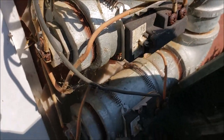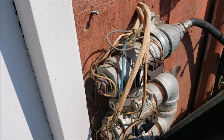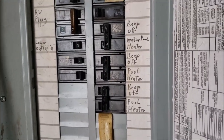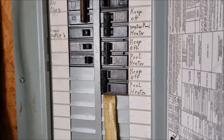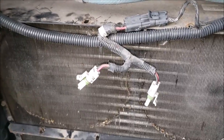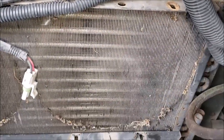Cold water feeds in from the bottom and hits element one, then two, then three. At six gallons a minute I'm maintaining about 120 degrees; if I slow the flow rate down it'll produce steam. I've got three 40-amp breakers powering the heaters on the back side of the wall. We also pulled the fans off — just four 10mm screws — to get in and clean all the crud. It's already looking a whole lot better, and we'll do the condenser and the radiator interior one more time.